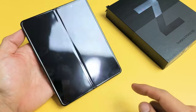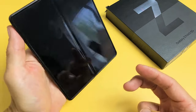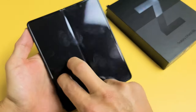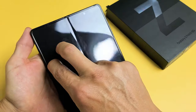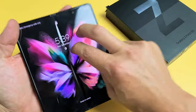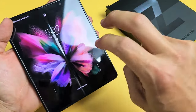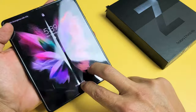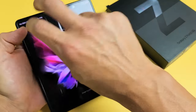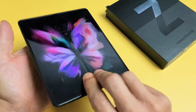Let's pretend we're in a boot loop here, and we'll start off on the screen. Hold the phone like this, use two fingers, and tap all over here. Sometimes as you're tapping this, even though you're stuck in a boot loop, all of a sudden it'll get out of the boot loop and you'll be at the login screen. So just keep tapping — don't worry if nothing happens and it's still stuck, just keep tapping all over.